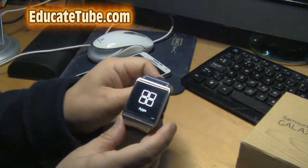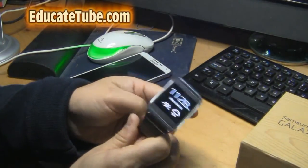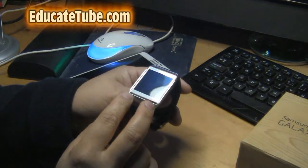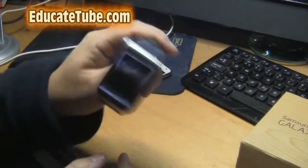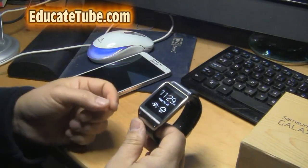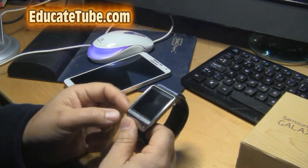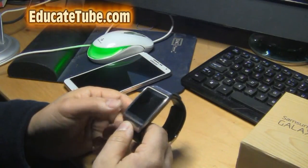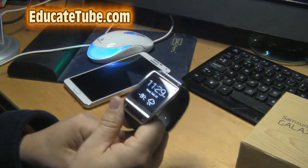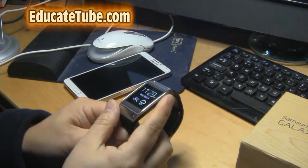The problem that these smartwatches suffer from is battery power. This Samsung Gear 1 will last maybe a day with the screen turning off every 10 to 15 seconds. You flick your wrist and it turns on again. If you do that, it will last a day. However, in my other videos I'll show that if you mod it to the native interface — it's actually Android 4.2 — and turn off the automated wrist-flick activation, using just the button instead, the battery will last even longer, maybe two or three days.